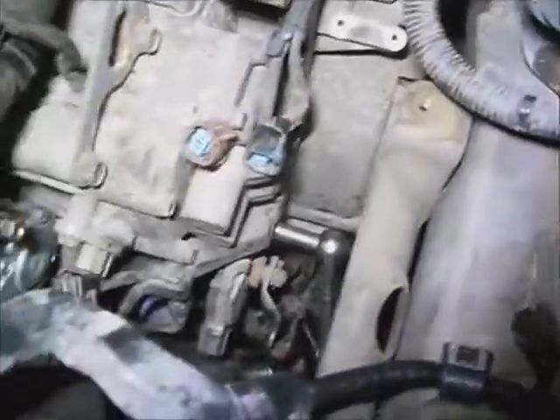This is the old harness — you can see one of the 10mm bolts holding the harness down, right under the Y where the ratchet's on to it. I removed that one from underneath the big part just below the fill plug, so I can get that sensor unplugged underneath of it. The park cable is out of the way and propped up. Unplugging any other wires on the starter.